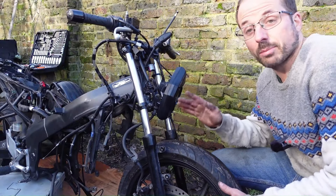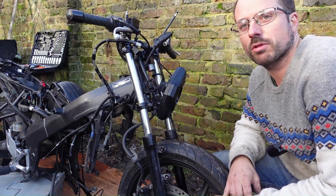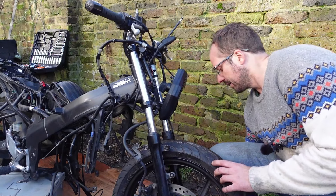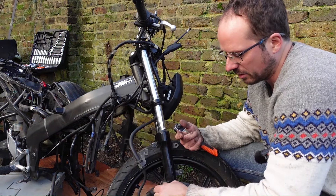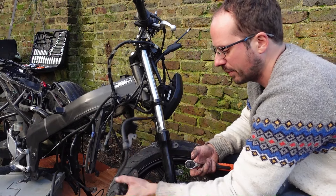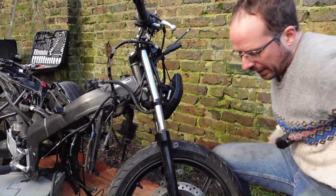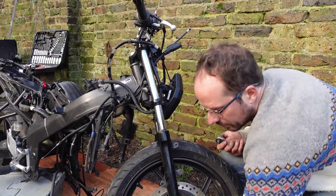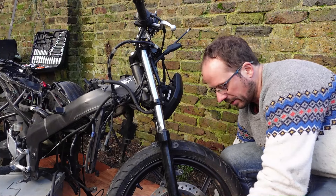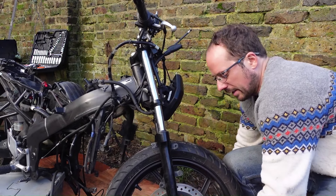To change the front forks I've put the bike up in the air at the front by putting concrete blocks and a piece of wood through the back. I need to remove the brake caliper — two size 12s and I'll put them on the floor and put them back in a minute. I'm going to completely rebuild this caliper, so I'll put it up out of the way. On the wheel it's a size 14 on the disc side and size 19 on the other side.